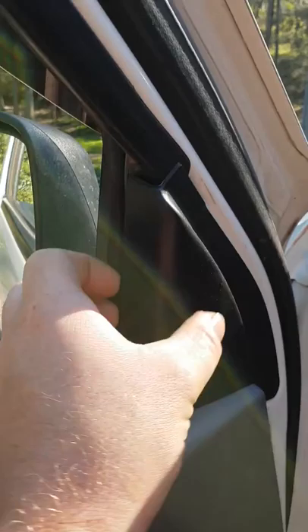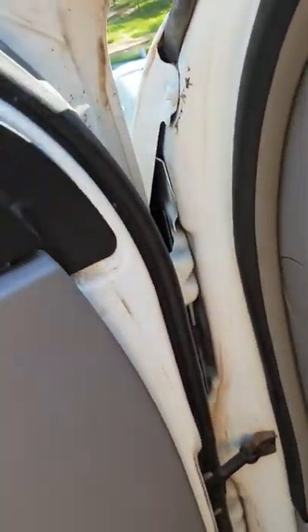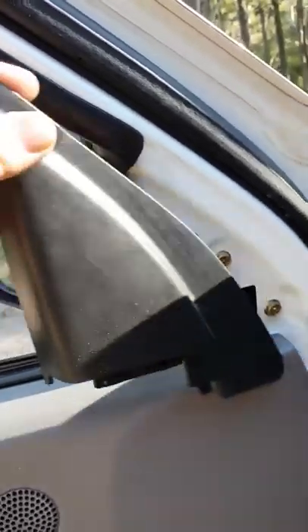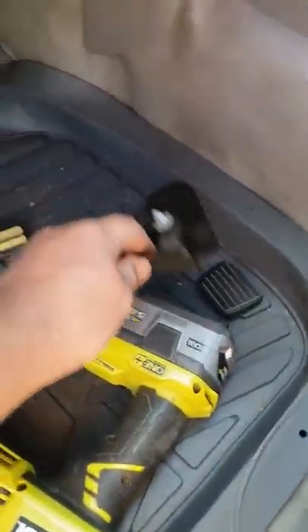The task is to get the door off and the first thing we want to do is put down the window. Next thing we want to do is get to this fella here and pop it out - just fingers behind here and it pops out. It's got one clip holding it in - pull up. I'll demonstrate in a minute. This clip goes in that hole and you got a tab here that goes inside that hole. So the tab goes down then the clip goes in - put your fingers back there, pull it back, lift it up and you can do it out as you please.